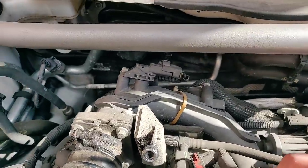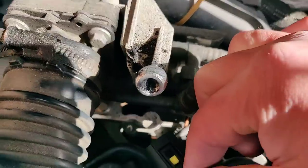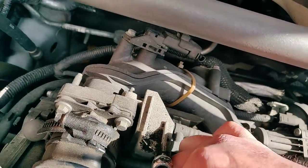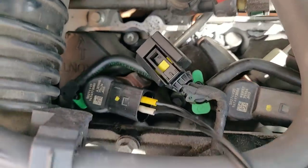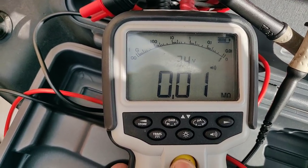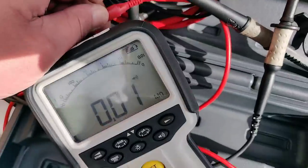What we'll do now, we'll just swap that back over onto cylinder one. Swap the leads over onto cylinder one. So there they are on cylinder one — we'll run the same test. 3.4 volts. I think the polarity's the wrong way on that, so I'll just swap my leads around quickly.